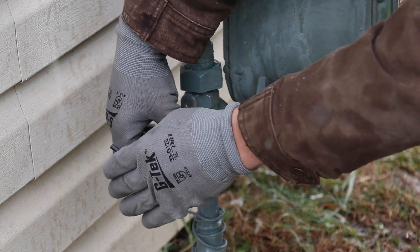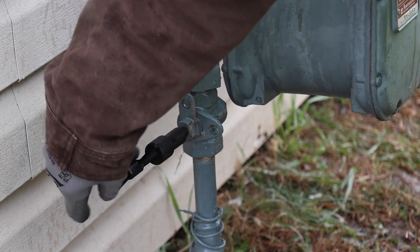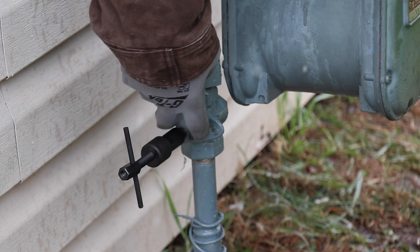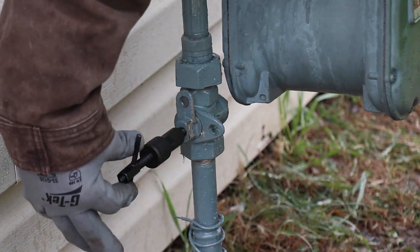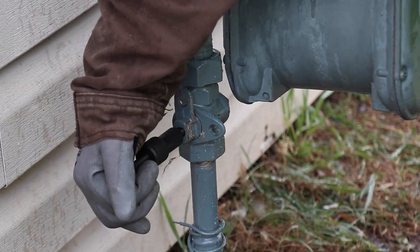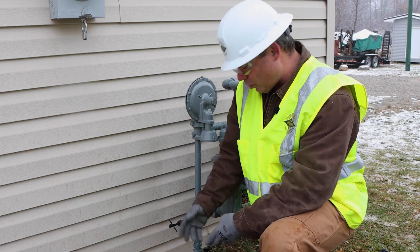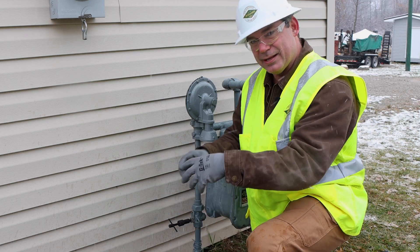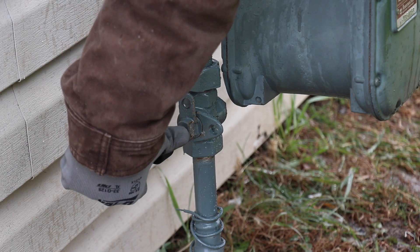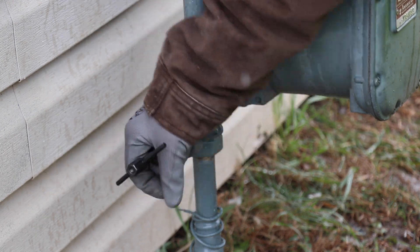So I'm going to spin my tool on — it's in. Now what I'm going to do is spin and push our grease into the core. When we're doing that, we're going to do it until we feel resistance. The reason we feel this resistance is the grease has been pushed onto the core. Our core actually has lines on it that the grease follows as a track. So I'm filling up that core, and that's pretty good resistance, which is an indicator that we've got grease fully on our core.